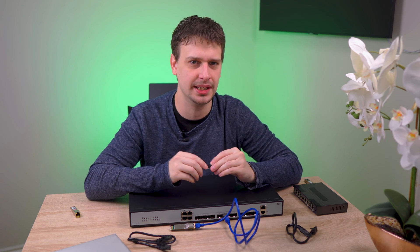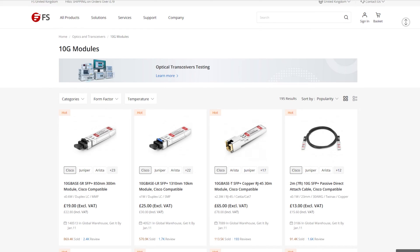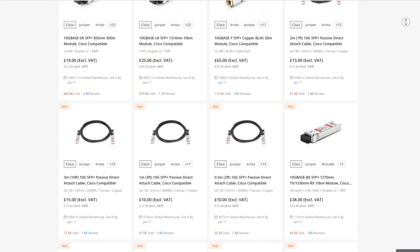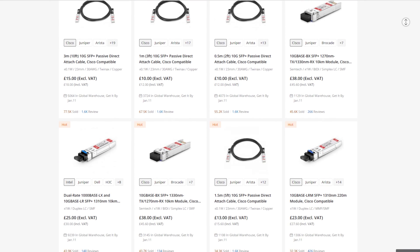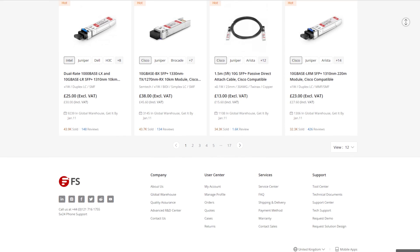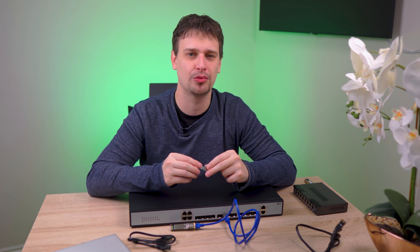Here's where things can get a little bit tricky, but if you know what you're looking for you'll be okay. All transceivers are not equal — they all have their own specs, and any reputable site like FS.com will clearly display the type of cable and maximum length the transceiver can support. So while Cat 6A will support speeds of 10 gigabit up to 100 meters, if you want to get that full distance the transceiver will also have to be rated for 100 meters on both ends. Transceivers that support shorter distances are often cheaper, so with some planning you can save some cash if you know how long your cable runs are going to be.